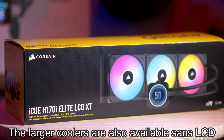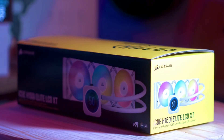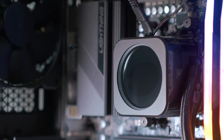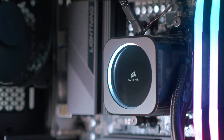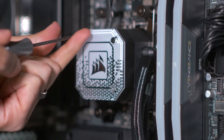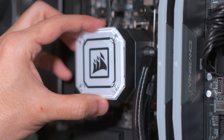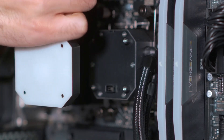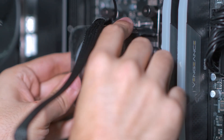All Capellix models also include an upgraded version with an LCD. The cooling performance between all versions is the same, so you'll get the same great performance regardless, but the LCD does offer a few visual flares and benefits. What's nice is if you buy the non-LCD version first, you can always buy the LCD later as an add-on — just swap it in by removing four screws on the top of the water block, which is also how you swap in different water block color designs. Note that the LCD requires an additional USB 2.0 header, which might be a little tricky to plug in depending on placement.